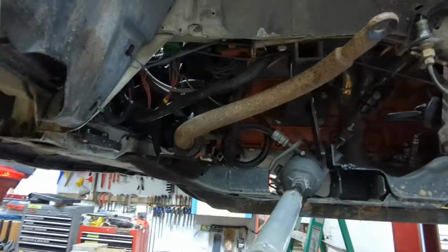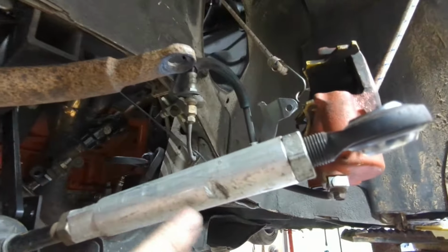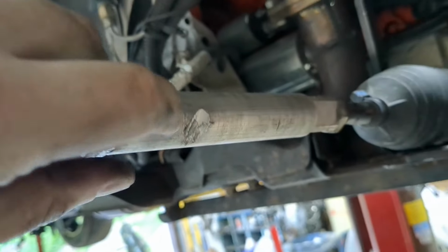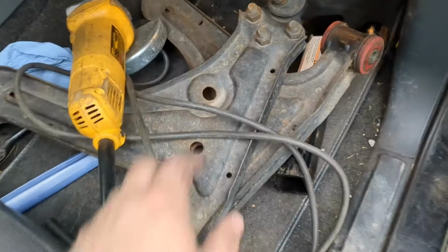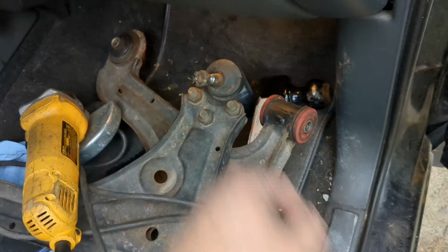And changing up my steering. I got some offset heims coming in, so I will quit grinding these against the inside of the wheel. This one's real bad. My turning radius kind of sucks, which is extra annoying when I got that trailer hooked up. I'm also going to take these control arms, chop them, and re-weld them so the ball joint moves forward an inch.